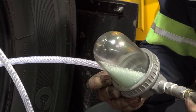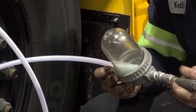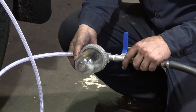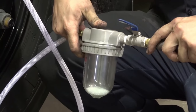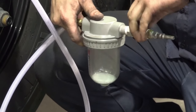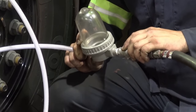The injection process takes about 30 to 40 seconds, so simply watch the avalanche before the river of beads flows smoothly into the tire. If the beads stop flowing due to clogging of the valve stem, you've simply gone too fast. Shut off your air release valve, remove your air supply from the pump, open up your air release valve, and the pressure from the tire will escort the beads back into the reservoir — then continue.